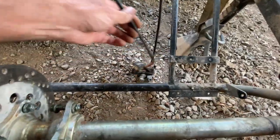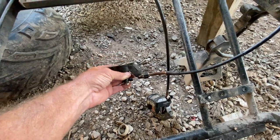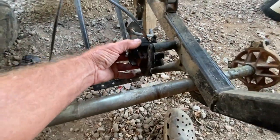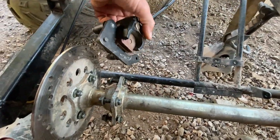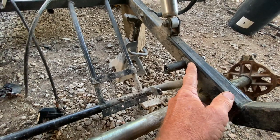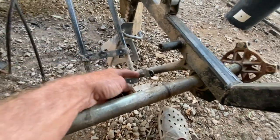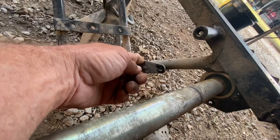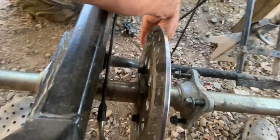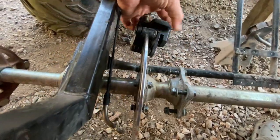The reason I'm having to remove the park brake is because this is the park brake, and apparently some of them on YouTube their cylinder wasn't made the same as this, or they didn't mention it. But this has to be removed because this is the brake caliper - it was mounted over here. When you flip the axle you've got to flip this. Some people cut this off but I don't want to weaken this beam. I can drill a hole on the other side and get a spacer. The reason you have to take the park brake off is because when it flips over, the park brake side was going to hit the frame.